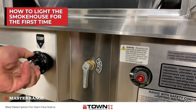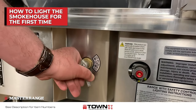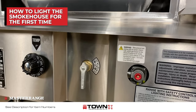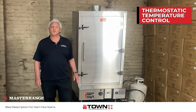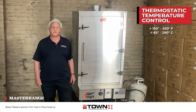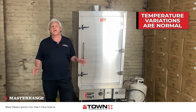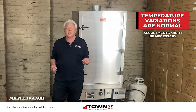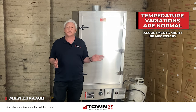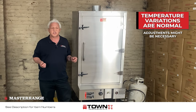To quickly shut down the main burner, simply turn the main gas valve off. The thermostat provides rough temperature control between 150 and 550 degrees. Given the large cabinet, it's normal to find some variation throughout the unit. You may find it necessary to adjust the thermostat for desired cooking temperature or rotate the product inside.